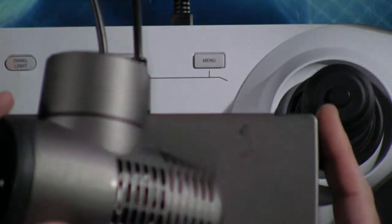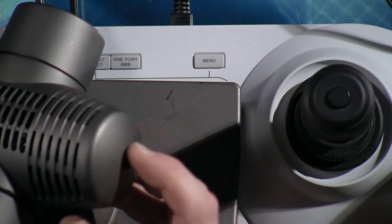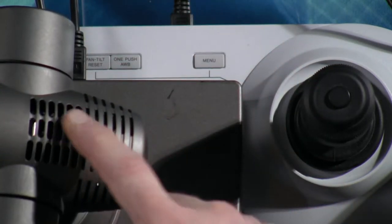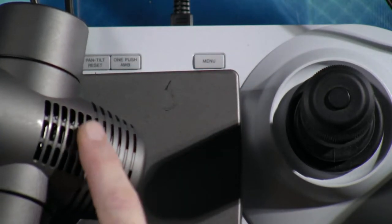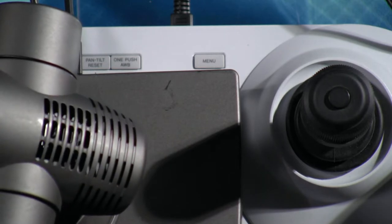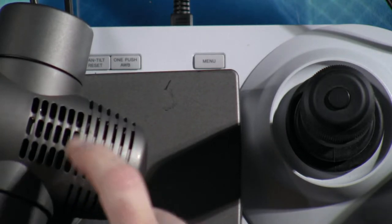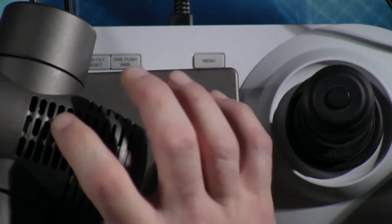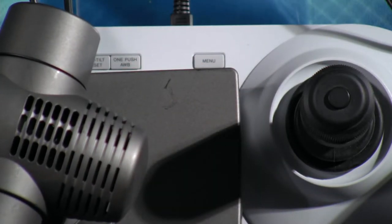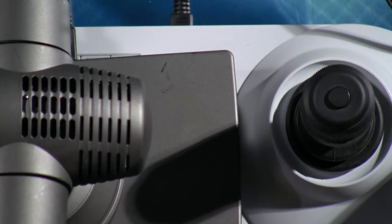I don't know if you can see it or not in there, but it's right there. And there's a couple screws just to remove this top shell, but you can just use an aluminum heat sink and put it straight on that IC unit, and it works all day long. I should have had one out to show you, or you could just cut this off and unconnect. There's an easy connection for this fan. And then just use one of those gray, sticky type thermal paste, but they call it thermal tape.